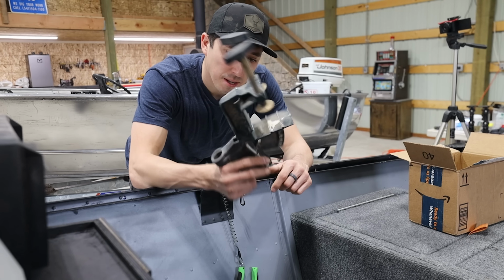What are you thinking? I'm gonna cap off this yellow and blue, because we don't know what that's going to yet. We're gonna have to do some testing. I'm gonna get power to it. So I need to crimp on a couple things here for you. So we're gonna put a couple of these spade terminals that'll fit 10 gauge wire, which is these yellows.